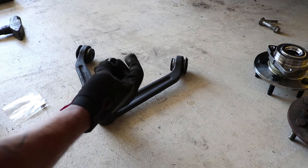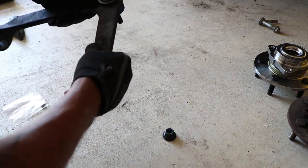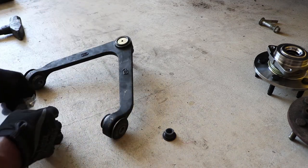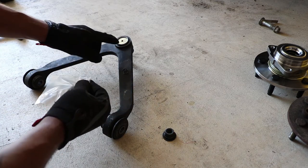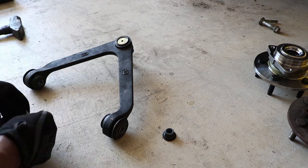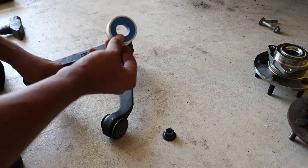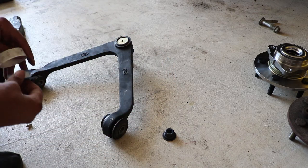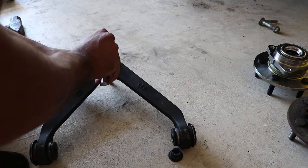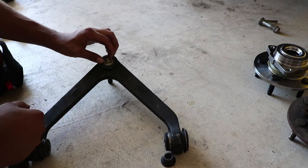The new upper control arm comes with a slick cover in a nice powder-coated black — I really like that. But here's the main difference: you can see this hole in the top, that's for the grease fitting, and it comes with the grease fitting included. All you have to do is thread it in and apply some grease. Before installing the fitting, I'm putting a little bit of Teflon tape on the end — just a tiny bit — just for good measure, until it's nice and snug.